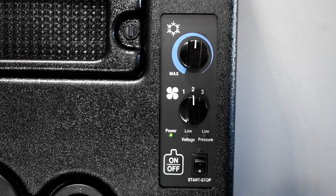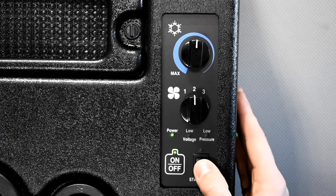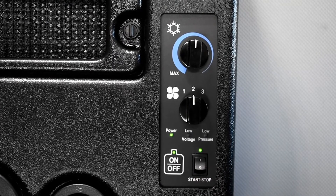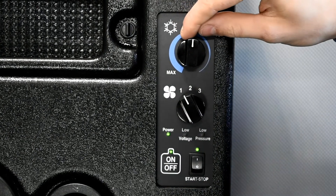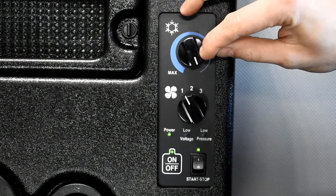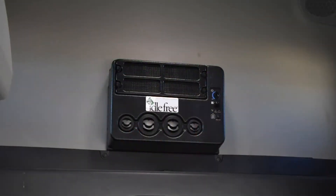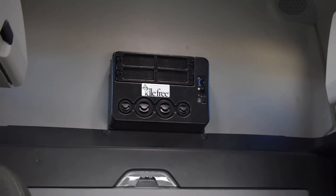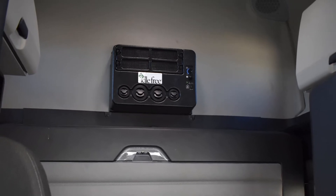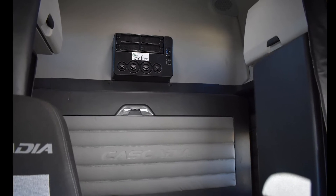To monitor the battery charge level in the winter or when the AC is not required, turn the EAPU ON by pushing the ON-OFF button. Turn the AUTO START-STOP ON. Set the fan speed to LOW. Turn the temperature knob all the way to the right for minimum cooling setting. Use the bunk heater for normal operation. Note that using the EAPU fan to circulate the air in the bunk while operating the diesel-fired air heater will distribute the heat more uniformly and make for a more comfortable bunk area.